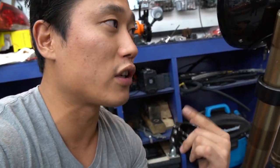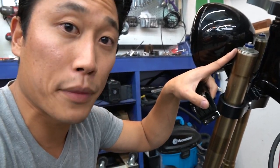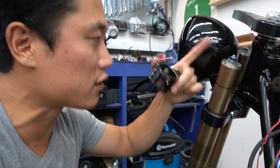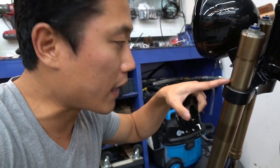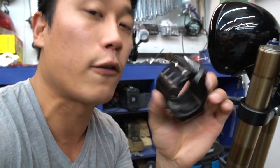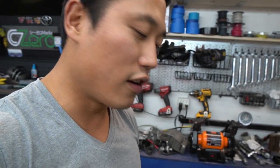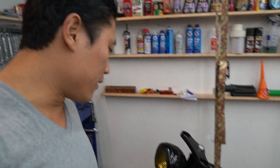I'm running into this situation because of lack of research on my end. Some ZX600 forks, depending on the year - which you can clearly see in eBay pictures - have a consistent fork diameter up top. Some are like 48mm all the way into the lower clamp, then expands to 50mm consistently, which makes it much easier - you just get a 48mm, slide it down, clamp it. Learn from my mistakes, guys. I already have the 2006 front end, so it is what it is.